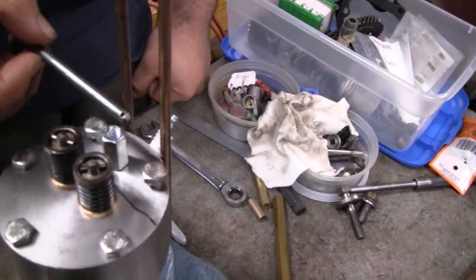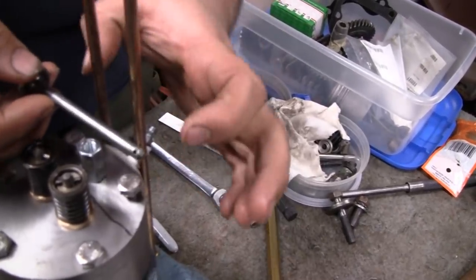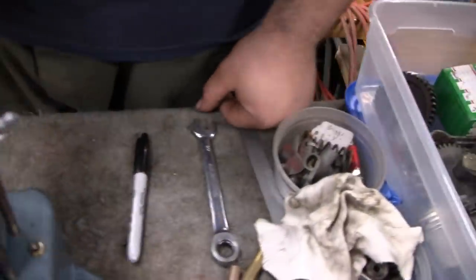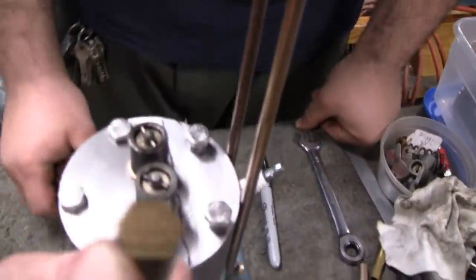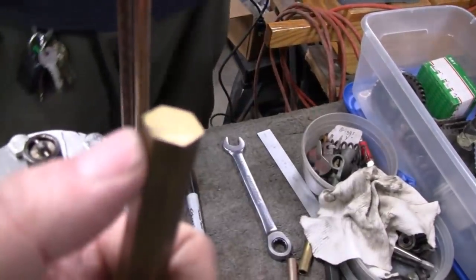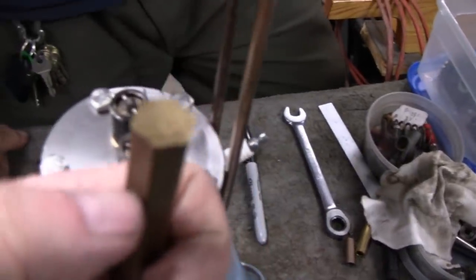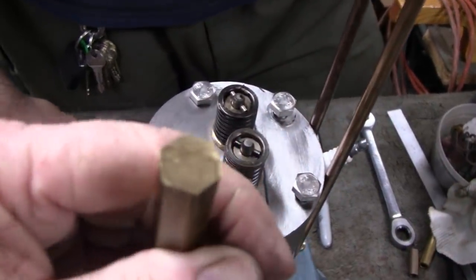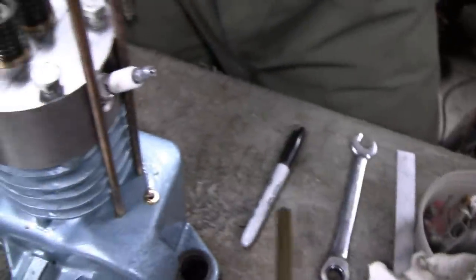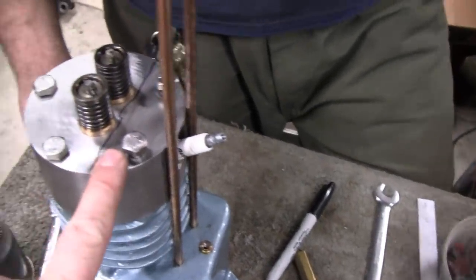Yeah, I like the single pedestal idea rather than the long shaft held on each bolt. Right. You know, I like that better. And then, like Mike said, it's going to go through the hex here. Right, through that. And we'll probably round off this, dress it up, round it off, and then countersink a bolt, a small Allen screw, to hold that pin in place. So that's where we're at here. So now we can't go any further right now with this until I get a brass plate.